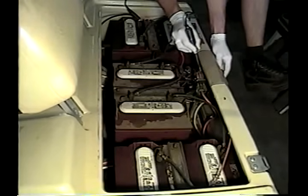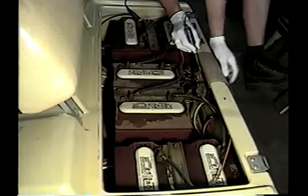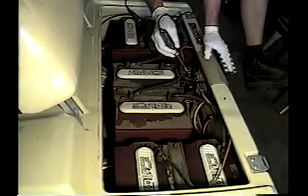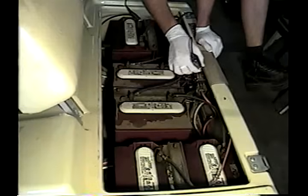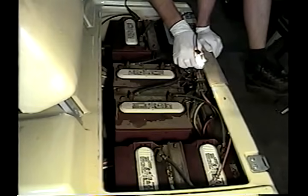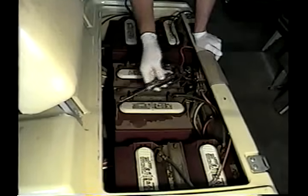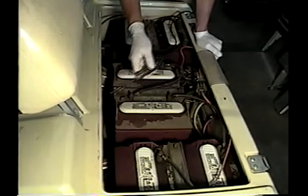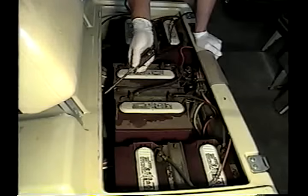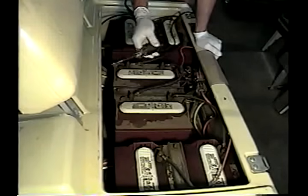To make sure this micro switch is working — note that it will also give us light even if it's in neutral — put it in forward or reverse, probe the other side of that micro switch, activate the pedal again, and we get a light there. That tells us that side is working. Now we can go back to the solenoid and do that same test right on the two small terminals of the solenoid, just like we did on the other cars. The solenoid is hidden under here.